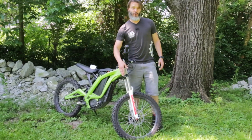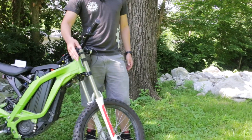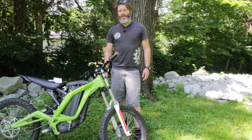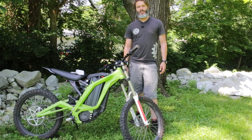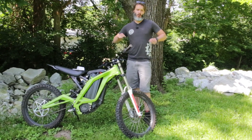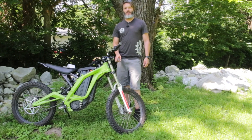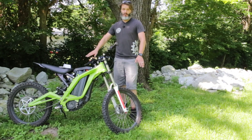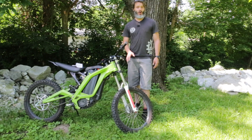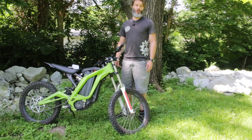I did end up having trouble with the forks that came with the bike, so these are some aftermarket RockShox Boxer World Cups I had laying around — I think these are 2010 models, pretty old ones. The original fork was air-sprung, and the problem was that air was going from the bottom chamber to the top chamber, constantly losing pressure. So the fork would jack down lower and lower, and I would lose my compression rate. The factory actually changed this right after my first-version bike — the second version that came out literally months after I bought mine did not offer the air-sprung fork. The motorcycle-style fork that came with it was coil-sprung from that point on.